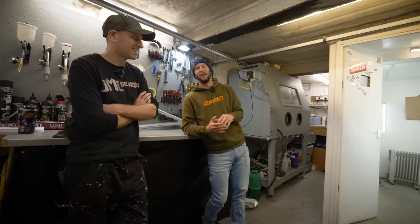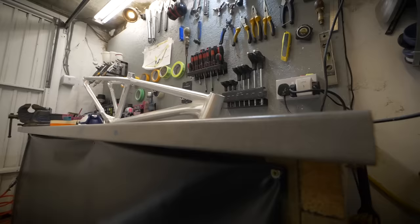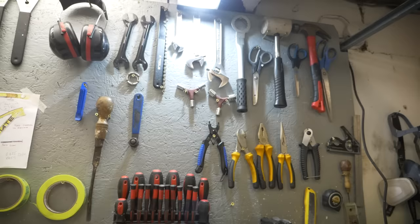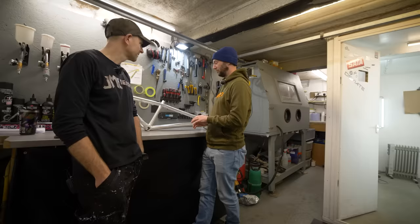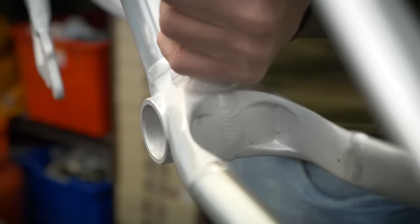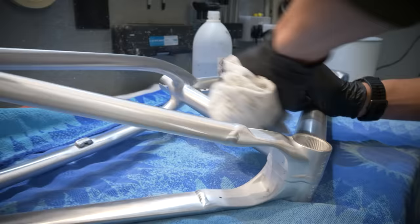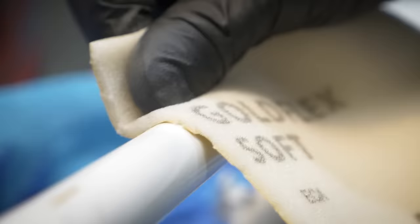Paul, thank you for having me down at your place. It's been a long, long time coming. Basically, I have got this lovely frame here which I think deserves a bit of customization. I'm going to be doing it with a rattle can — I don't have all the fancy equipment, but I've come down here and you're going to teach me a little bit. So, first up — you've got a raw frame, which is a great starting place. The first thing you need to do is give it a good clean and a degrease. Once that's all done, you want to make sure that it's been keyed up. In this case it's pretty well keyed, but you can go over it with a bit of sandpaper just to take the shine off.